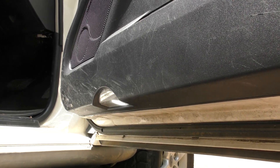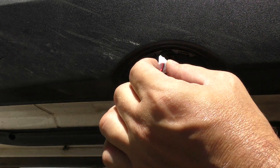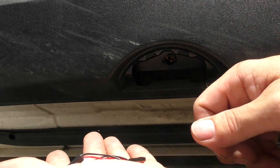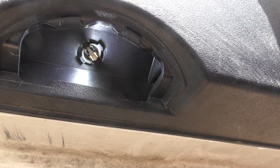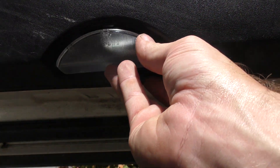Let's come down and have a look at the ones at the bottom of the door. I believe these ones were a T10 - come in from the end, lever it down and she'll pop out. These ones are a T10 in here. As I said, I've gone with this kit which gives you the festoon fitment plus a T10 fitment as well. I wouldn't mind actually changing over to these little T10 globes - we'll see how they go. What you need to do is get your globe in there, and because the door is open it will come on when we get the right fit - and there we go.